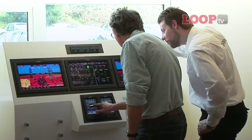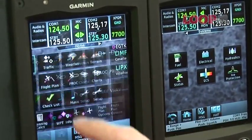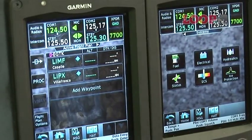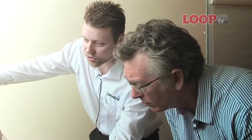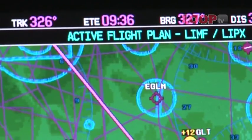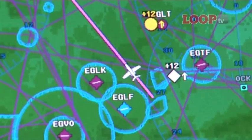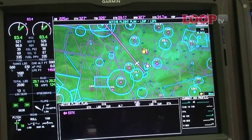It is just like using a little touch screen computer. You've got all your flight plan information, so once you've done your direct-to, or if you want to build a flight plan, you can go straight there. As you press it on the touch screen, it also brings it up onto your MFD to show you where you're currently situated and what's in your flight plan. As you manipulate the touch screen, it'll add it to your display so you can see what's changing.